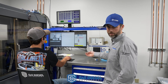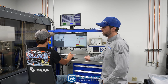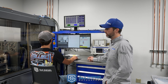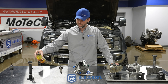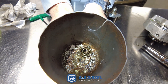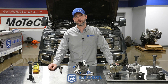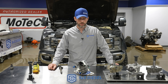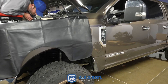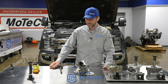It's actually pretty impressive — I was definitely expecting it to be at least a little bit high. It's got 110,000 miles or so on it, and at least the last few months have been pretty rough. But those injectors are pretty tough as long as they don't get fed metal from a pump failure. We got the pump back together, got the injector back from finishing testing, we're going to put it all back in the truck with the parts that came out of it. We'll flush what we can out of the rest of the system, put new filters on it, and put her back together. This unintentional surprise test really worked out great for Dane — essentially no cost. I'm still shocked we didn't have more problems, that even the injector was great.